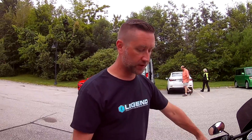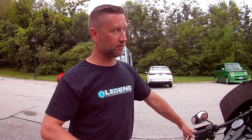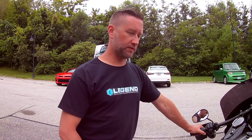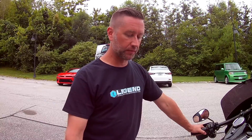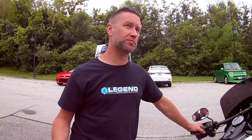Two things we're always focused on — first and foremost is improved ride comfort. Any rider under 250 pounds on the newer Softails, and even on the new baggers, is definitely going to gain from a system like this because the stock rear suspension is really over-sprung for lighter riders. We can increase the comfort level for those riders. Also, this system allows you to actually lower the bike for a customer who needs that confidence in a parking lot or stoplight to stoplight.